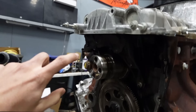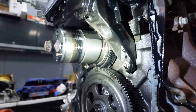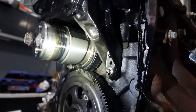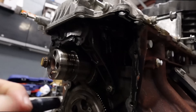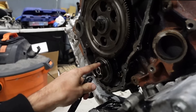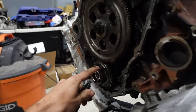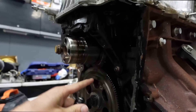So Sean got the camshaft installed. The next thing before we put the front cover back on this engine is I'm going to weld the crankshaft gear right here. Typically when these things are making a lot of power — or even sometimes when they don't — that's just a press-fit cam gear. The crankshaft spins the camshaft, which also spins the high pressure fuel pump up at the top. People weld these cam gears on the crankshaft so that way they don't spin.